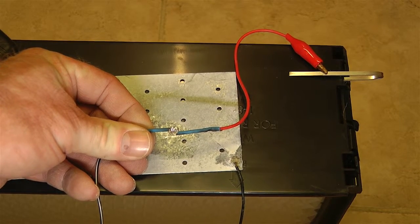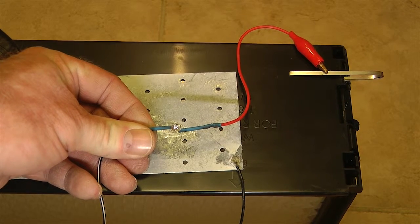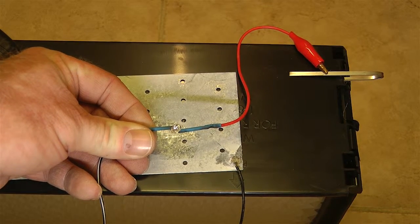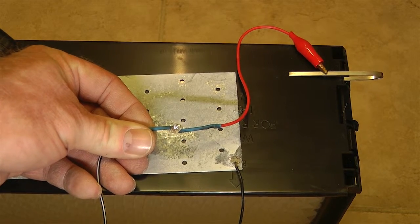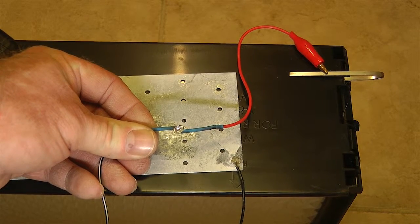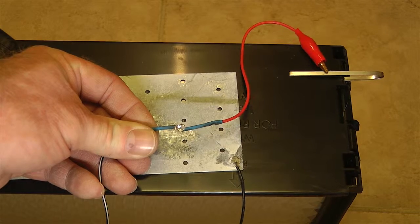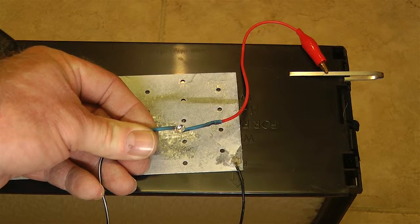It'll be fairly bright, maybe around 50 microamps, and that current will tell you that the wicking media is really clear of calcium. Basically, it's not built all the way shut, and it tells you there's plenty of air passages available. Once it gets really dim, that means you've got to change it. What I've said is relative: really bright means it's okay, really dim means it's changeable. When you look at it, you'll get a good feel for what's going on.